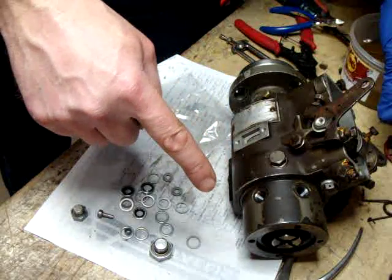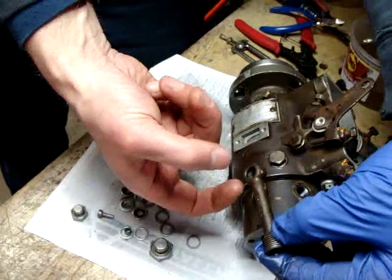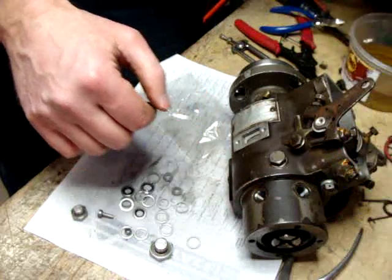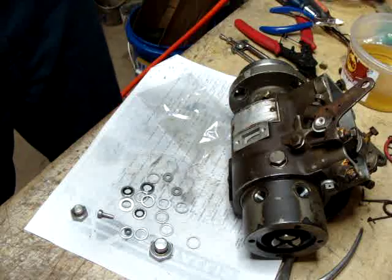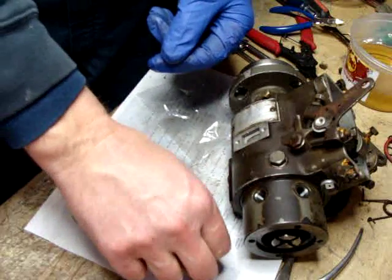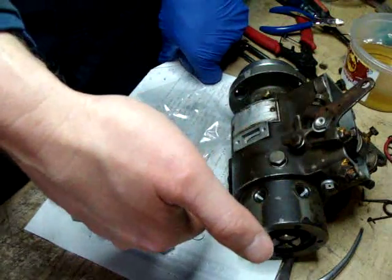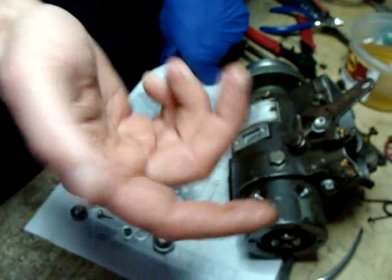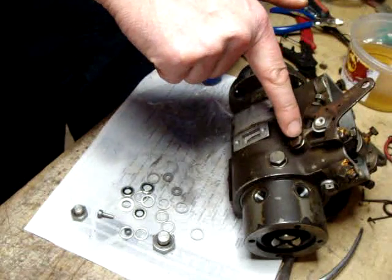The question is: what's supposed to be used to seal these? Is it supposed to be a crush washer on each side, or an O-ring on one side and a crush washer on the other? I think I'll look at the parts list to get an answer. The parts list shows call-out number 84 — same part number for the inside and outside of that banjo fitting — describing it as a plain washer, and it says there should be 13 of them. Two per hole times six should be 12, and then there must be a 13th one used somewhere else, maybe even on the current bolt I'm thinking of replacing.